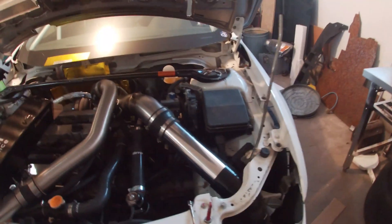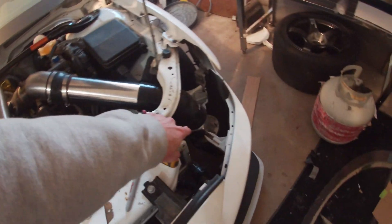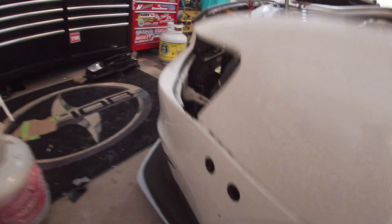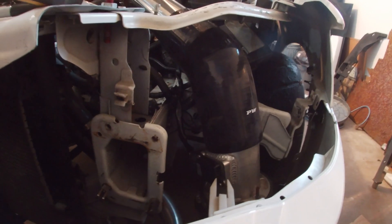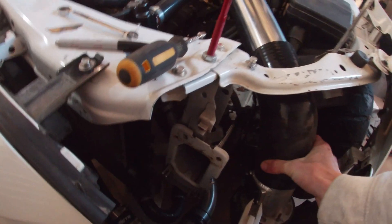I just kind of mocked up the cold air intake and lucked out really easy. It's got a piece of three and a half inch pipe to extend my mass airflow housing, and we just added in one more 45 degree coupler. The filter is nice behind the bumper. When I build the splitter, I'll have to build a piece to block off so we're not throwing anything at it from the tire. The wiring for the mass airflow sensor reaches, so I didn't even have to extend wires or anything. I'll just build a bracket to attach it to the frame rail so it's not flopping around.